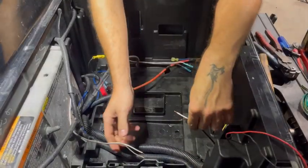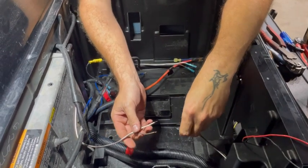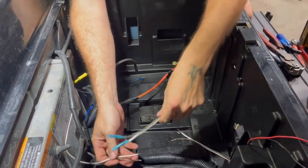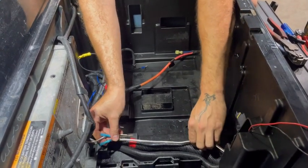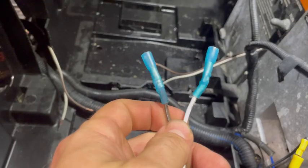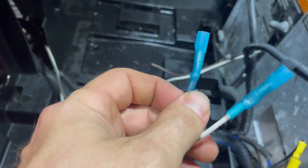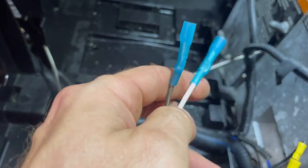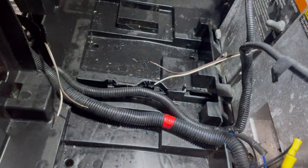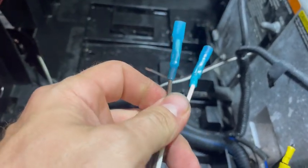This cart has an additional wire — not factory — that runs to the upper roof-mounted brake light, and it's kind of tight, so I'm going to add an extension so it'll lay nice and flat along with the rest of the wires below. Don't settle for the cheap plastic butt connectors; go the extra mile and get the heat-shrinkable ones. In my opinion, this is the best investment if you're going to be doing any type of wiring on your golf cart.